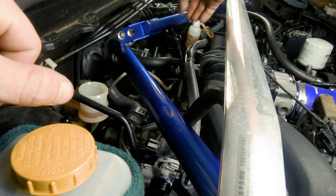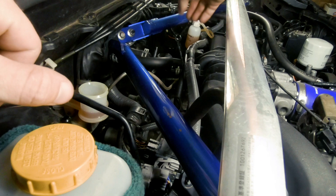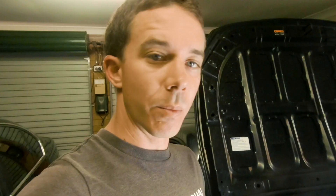One thing I didn't mention to make this job a little bit easier: remove the brake booster vacuum hose. Put that back in place now. And now we have clutch again — nice and easy job. Make sure when you're putting the master cylinder back together that you put the circlip back in very, very tightly. I had to pull it out again and reset it — this time I took a screwdriver and made sure the circlip was in there nice and tight. All done.